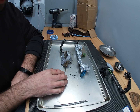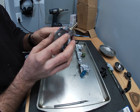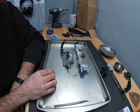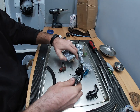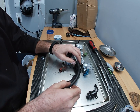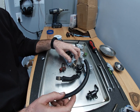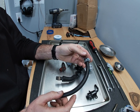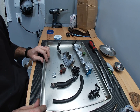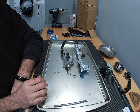That's a quick breakdown of how to do this modification. Make sure you get everything in there straight so the fitting sits nicely all the way around, and make sure you get plenty of wraps with a fuel-safe Teflon tape so you don't have any leaks. You're obviously going to need a new piece of fuel line long enough to reach back to your other lines, and you'll also need a hose clamp unless you want to reuse the existing ones. Thanks for watching, I appreciate it, and I'll see you next time.